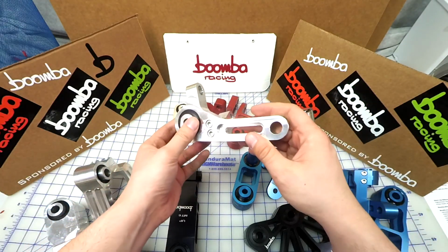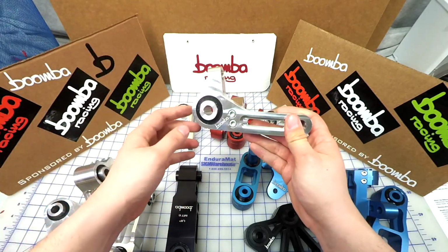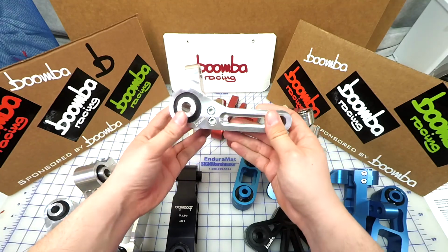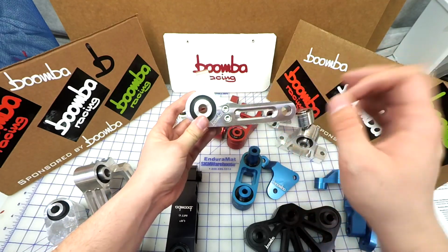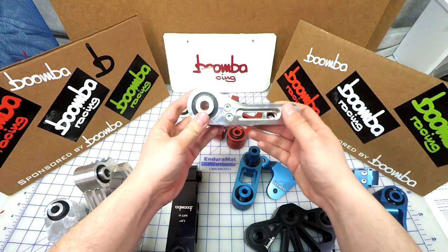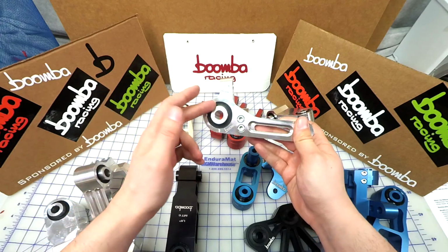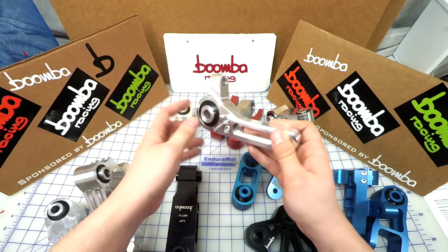When first installing these mounts, don't be alarmed if the first time you turn your car on you feel some excessive vibration. This is perfectly normal and it does break in within the first 1,000 to 2,000 miles. This is, as mentioned earlier, because this bushing area, which is absorbing the vibrations, is so much smaller than the factory one, which was gigantic compared to this. But, like I said, don't worry. You get used to it and they do break in a lot, to where those vibrations are dampened and you're not going to realize them nearly as much.